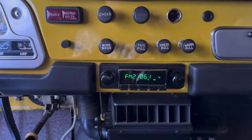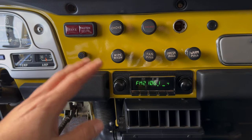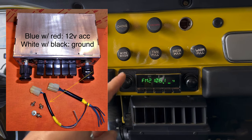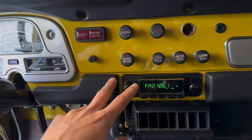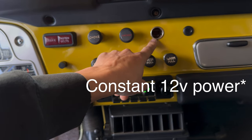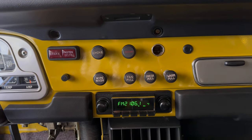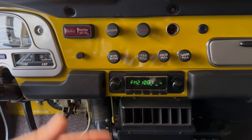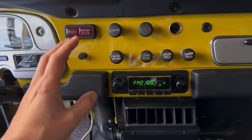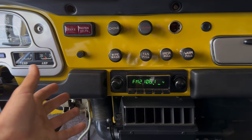The stereo install is all wrapped up. I was able to fit it in with the brackets that come with the kit and wired everything up with no problems. There's a tag on each harness for the power and the ground. The original radio harness is two-pronged — it already has your 12-volt ACC and the ground — so I just put two spade terminals right into it. I needed to find a constant 12-volt source, so I tapped it to the red wire on the cigarette lighter. I have the cigarette lighter removed so I can clean and polish that area, but that was my constant 12. You can get the highest version of this radio, which is what I got, or the middle version which is just as good, but I wouldn't recommend the base model especially for all this work.